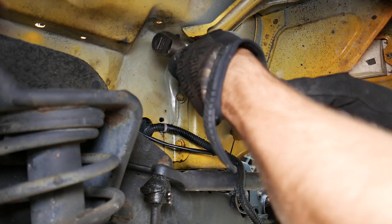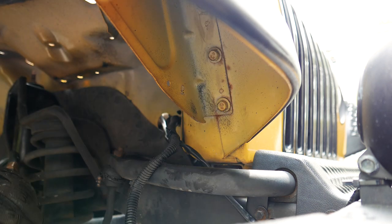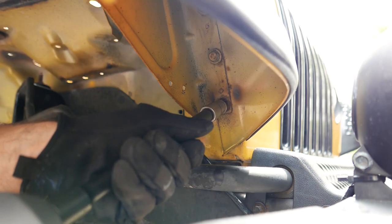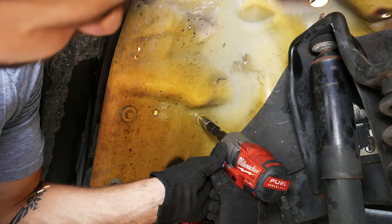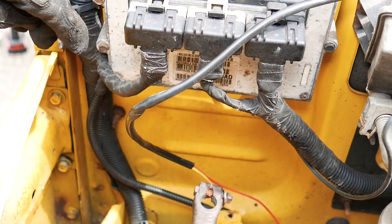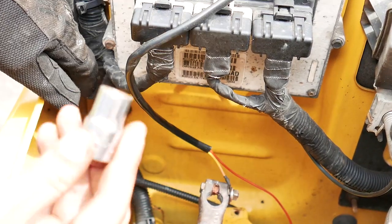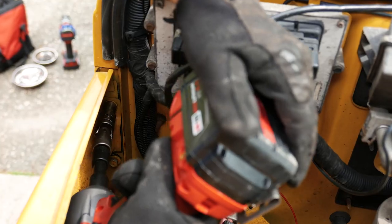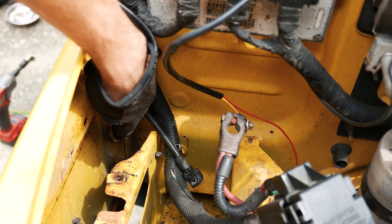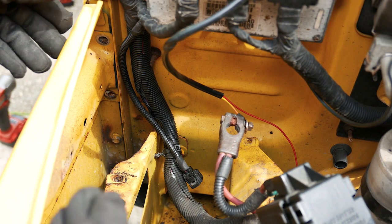On the front of the fender there are three bolts, and then there are another three bolts — six bolts total. Here are the other three bolts on the other side of that triangle piece, so take those out next. On the back side of the fender, go ahead and start with those four bolts. The last four bolts to remove are on the outer line along the fender — these are also half-inch socket bolts, so pretty much all the major bolts that hold the fender to the Jeep were half-inch. The bolt on the bottom actually broke, so we're going to have to drill that out after we get this fender off and insert a new rivnut so that we can use a new bolt.